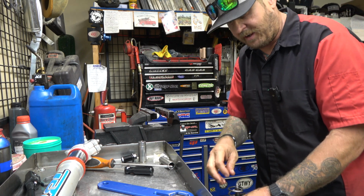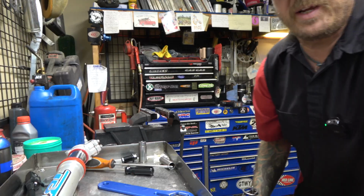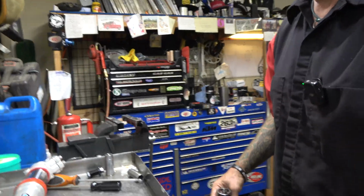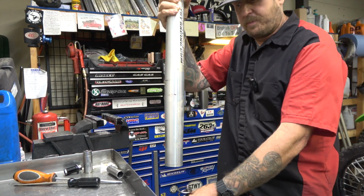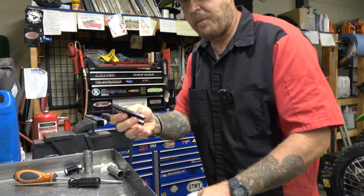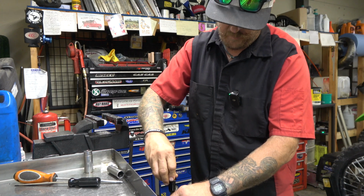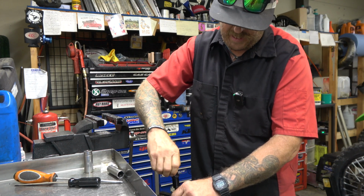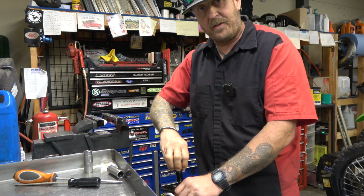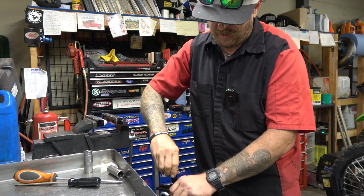Which is also what the 6500 kit recommends. So, to show you guys real fast, that setup, just like any other twin chamber fork. Take our tubes, slide it over, push down. Use our same holder as you did like any other thing. We use the Race Tech one. Bottom adjuster. I'm just going to go on by hand and run that down until it bottoms out on the rod. And then we're going to bring that other nut back up to it to lock it in. That way we know we get all of our clicks.